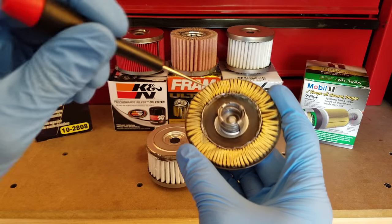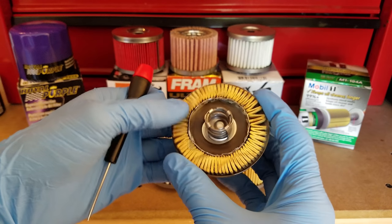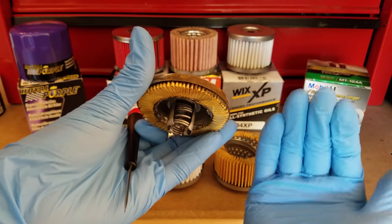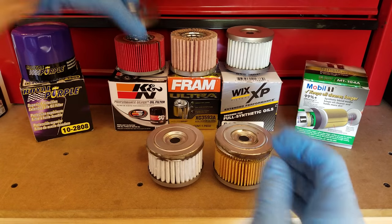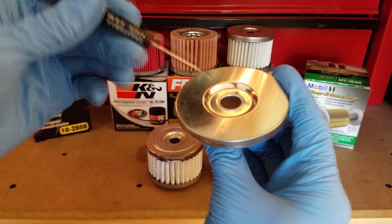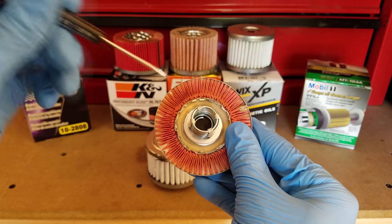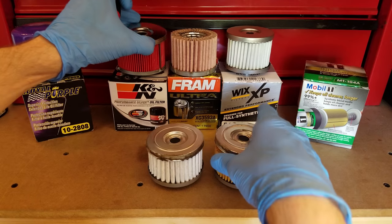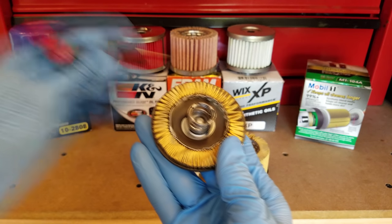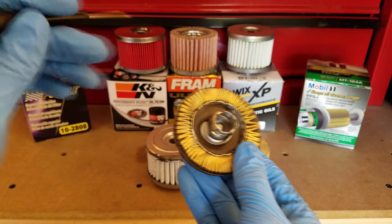The other thing I like is that immediately behind that rubber seal is a stamped sheet metal support plate that is meant to keep the seal flat from warping or wrinkling as it moves up and down. To K&N's credit, they do a good job on their performance silver filter by also using rubber for their seal, but instead of a dedicated support plate they just throw an extra coil on the end of their spring. I'm sure that works, but I think having a dedicated piece that spreads across the entire surface of that seal is just one greater level of quality. Really glad to see that.